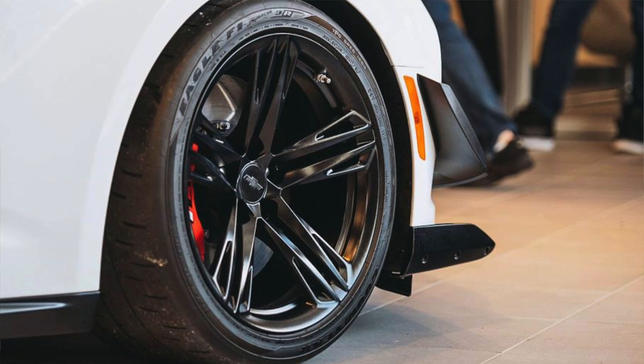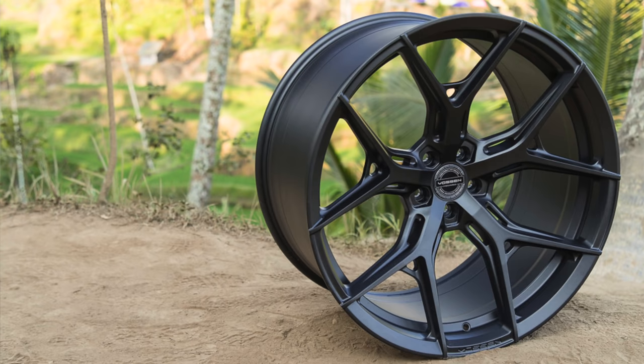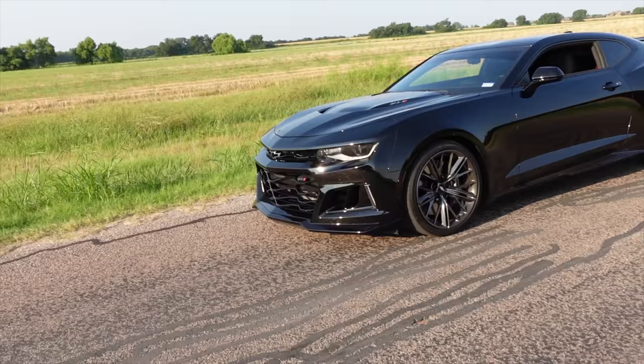The debate I'm having currently: number one, we go wider tires on our stock ZL1 wheels, throwing a little spacer in there to give it a better stance. Number two, we can order the 1LE GM wheels — about 3,000 bucks — you get the 19-inch wheel satin black with the wider width, 11 in the front, 12 in the rear. Or option number three, we can spec out some custom aftermarket wheels to the 1LE width. The issue there is I'm having a hard time finding 19-inch, and they have to be 20 if we go that width. So decisions, decisions.